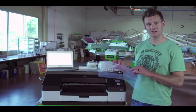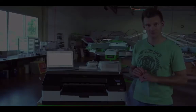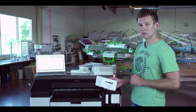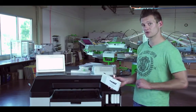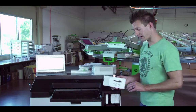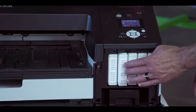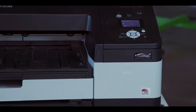Once we've ensured the printer is properly set up with the Epson OEM inks, we can now move to installing the Black Max inks. Take out the Epson cartridges and put in the Black Max cartridges. It's very important that you do not use a chip resetter during this process and do not get the chip dirty. If you do, clean it with a Q-tip and alcohol or a non-linted rag. Install the cartridge carefully into the printer bay and press it all the way in so it reads. Once all cartridges are installed, put your cover back on.